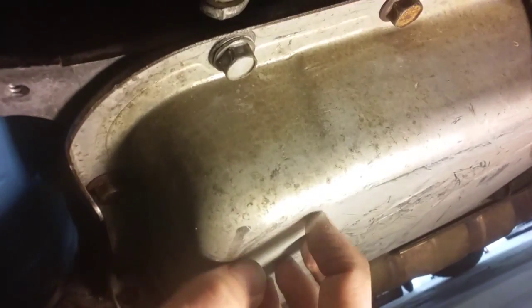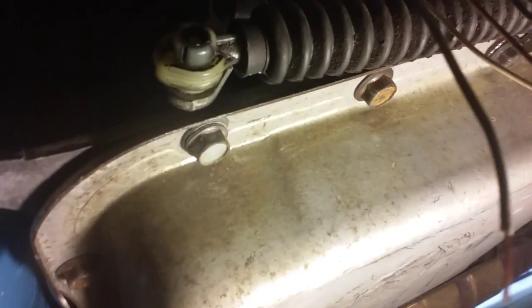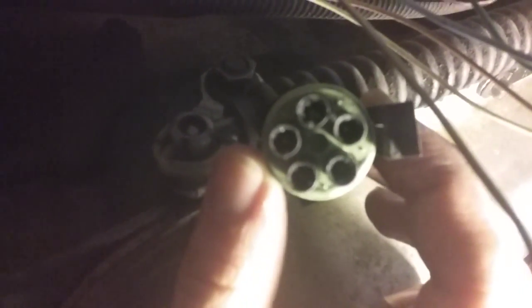The transmission in this car, I didn't know until I got it to the speed shop, is out of an 83 Camaro. So really they're mostly the same transmission. However, in 93 they have this 5-pin connector that controls the torque converter clutch, and what's required for the earlier 700R4, 93 and or 92 and earlier, is a 4-pin. So these 5 wires need to make it into here,